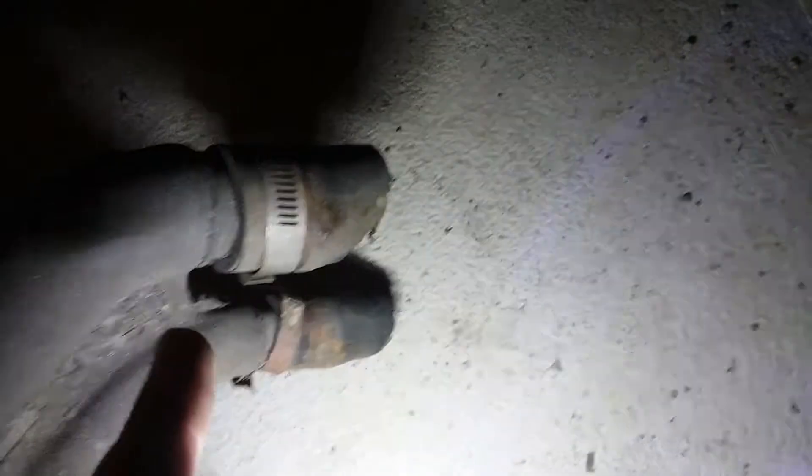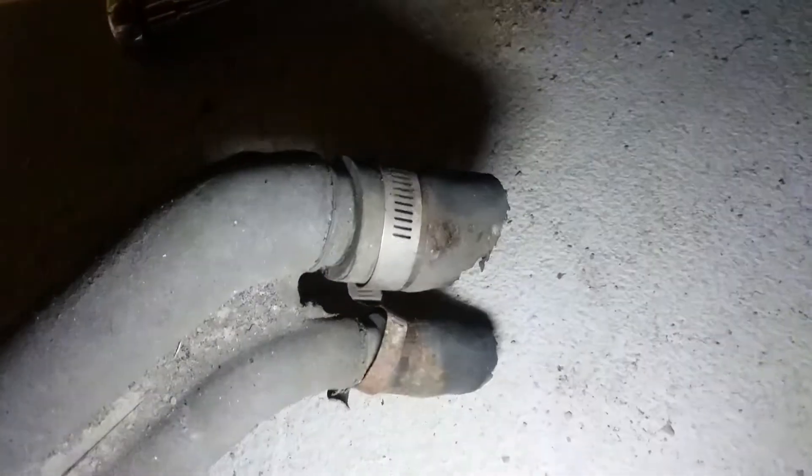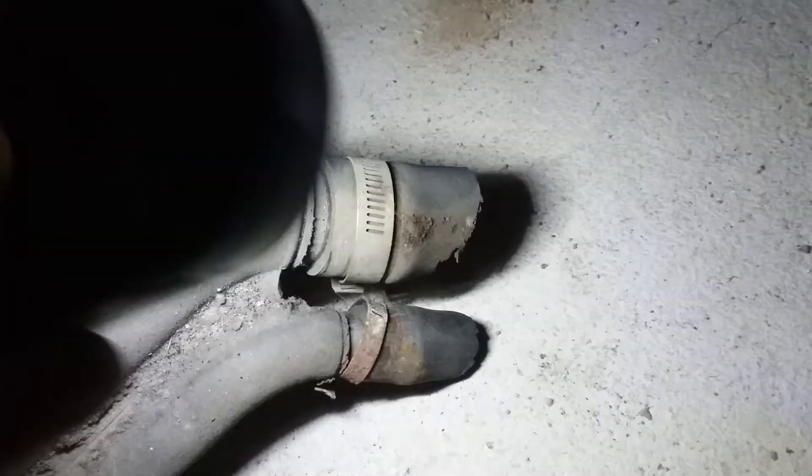First, remove the lines that go to the tank. This bigger one is the filler nozzle line, and the other one is the vent tube for the filler neck. I'm going to be replacing them so I just cut them off. Mine was replaced not too long ago so the hoses weren't willing to come off the nipples in a timely manner. They'll fight you pretty hard because the filler neck is metal, so it will rust and vulcanize to the rubber hoses and won't be easy to get off. As long as you're replacing the hoses — which you really should — you can just cut them.